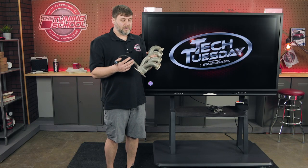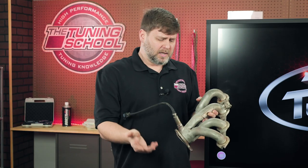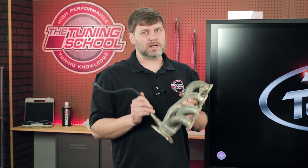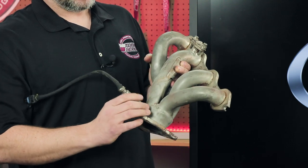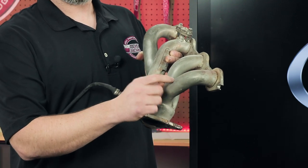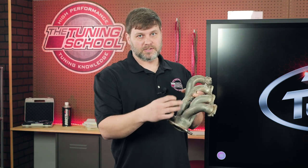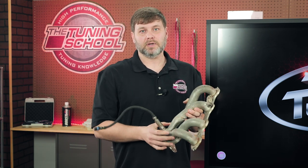I want to talk about placement in primaries. We've seen it where some people like to put narrowbands in the primary tube, and for your factory narrowband sensors it's not a great idea — your factory ECUs hate it. Primary tubes start at the head and run down to the merge collector. If you try to weld a bung in there, the factory ECU is not going to like it; it's going to see a lot of variation. So be sure to use merge collectors and extensions — everything's going to be good.